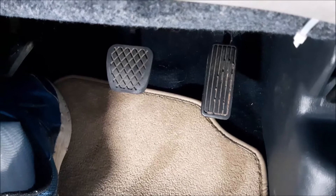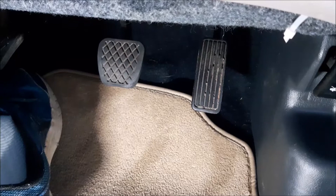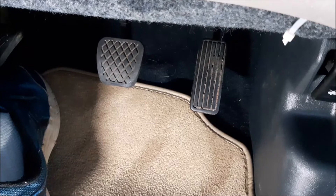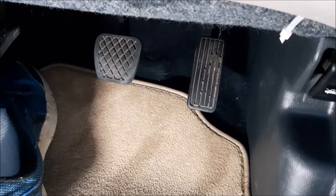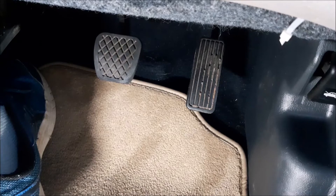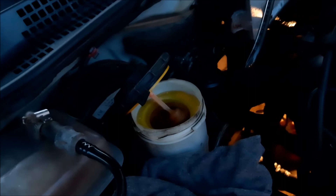A basic initial test — when you put your foot on the brakes, the disc should lock. Obviously the wheels are off and the car's not on the ground. Hopefully this gives you an idea of how we bleed the brakes and why, if there are two of you — or even a third person to pour fluid and keep levels up — it can be easier and more effective than an automatic one-person bleeding kit.